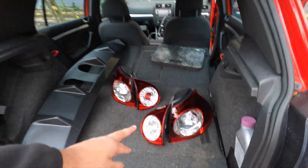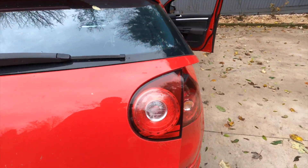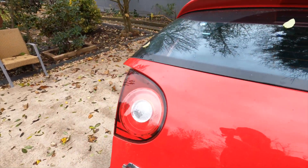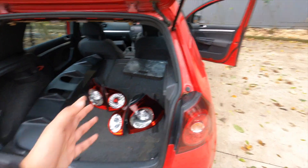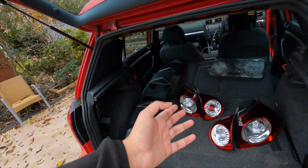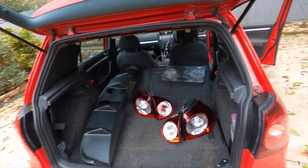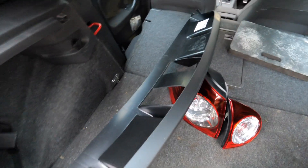These are actually OEM Volkswagen lights - they were never sold or given as an option on UK cars. They're really fancy looking. I believe the only thing that needs to be addressed is swapping the fog and reverse light over - on EU spec you've got the fog light on the left and reverse on the right, but on the UK it's the opposite. I purchased them new off a website called Autodoc. They don't always come into stock - they can be quite rare. I paid around £250, and generally they're around £250 to £300.